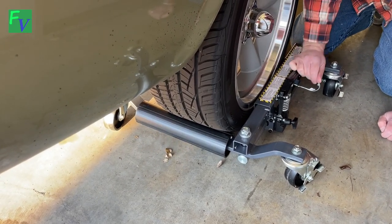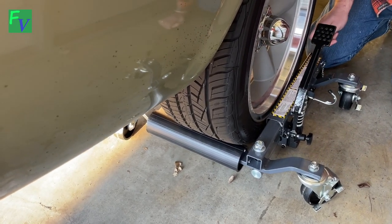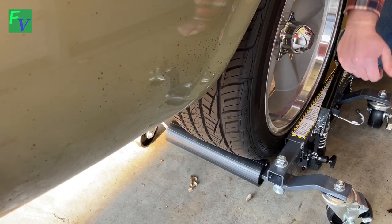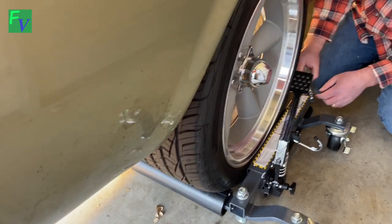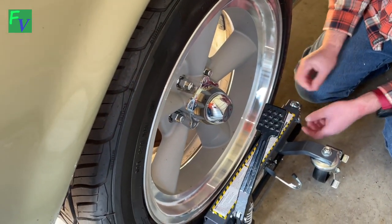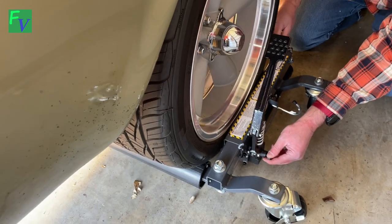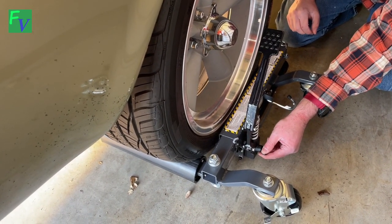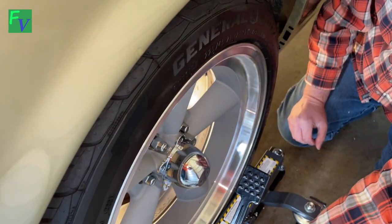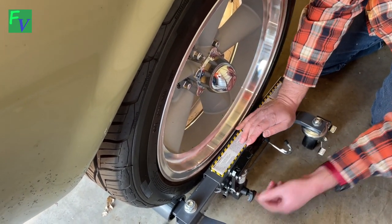There we go — tire is up off the ground. Looking inside here, we're clearing the rim. This is touching the rubber, but this part is painted so you're not going to scratch your rim or anything. Your pinned hole is just cleared. I'm just going to gently let this go — think of this like a latch. When you lower it down onto the car lift, it's going to slowly let some of this pressure out, it hits the pin and you're done. If you wanted to fold this down so it isn't sticking up, you could do this.